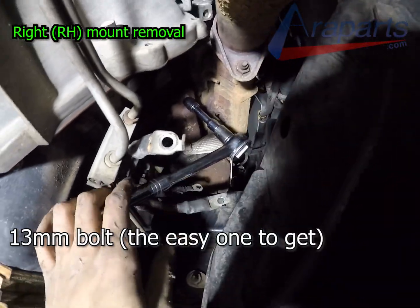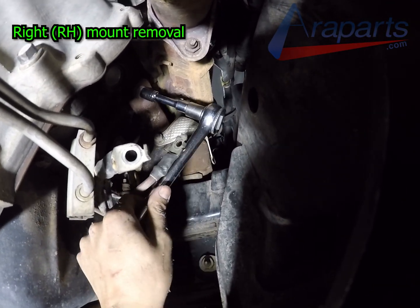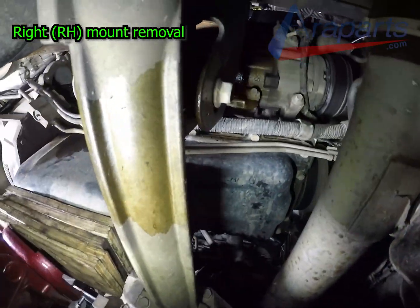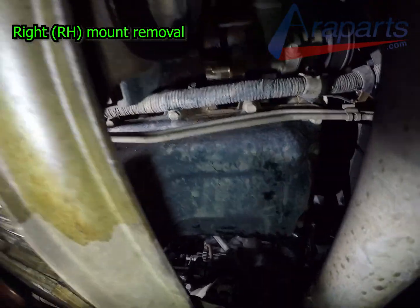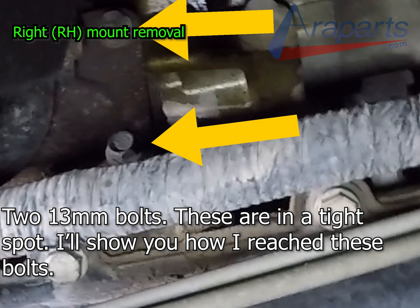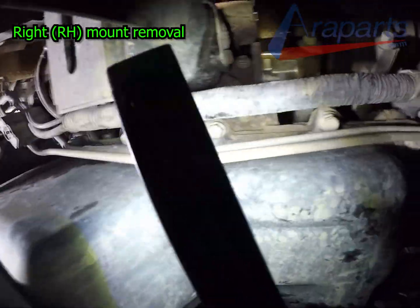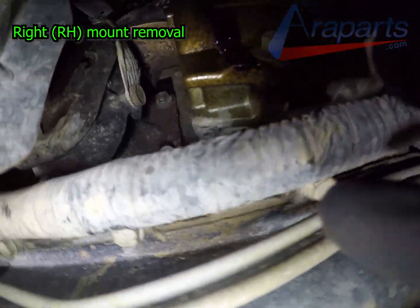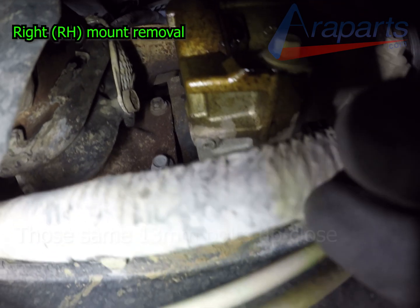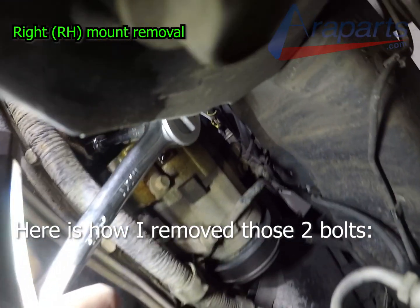Now that I've got it off, here's bolt one — I have some good leverage and I can break it through like this. Here are the bolts for the passenger-side engine mount, and they're quite accessible. Here they are up close — you can fit your ratchet in here. You will have to utilize an extension, maybe a wobbler socket, but you can reach in from here.